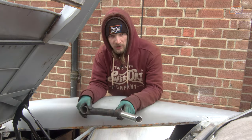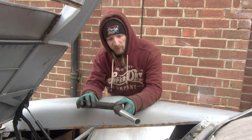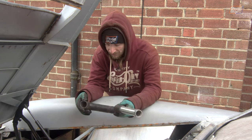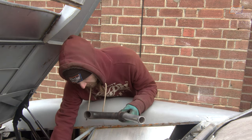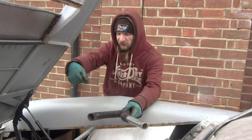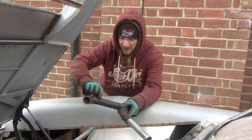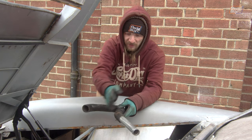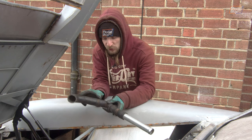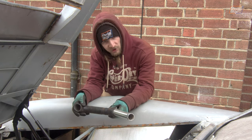The contraption we've come up with uses a couple of silicon hoses we'd bought before and some rubber bits salvaged from various VWs and Audis we've dismantled. The first piece is a 90-degree elbow on the radiator — it's going to flip 180 degrees, come out through a hole in the side, connect on, double back, and come back out roughly where we always had it. We might need to shorten one piece a little bit depending on how it measures up, but we'll figure that out once we start cutting holes.